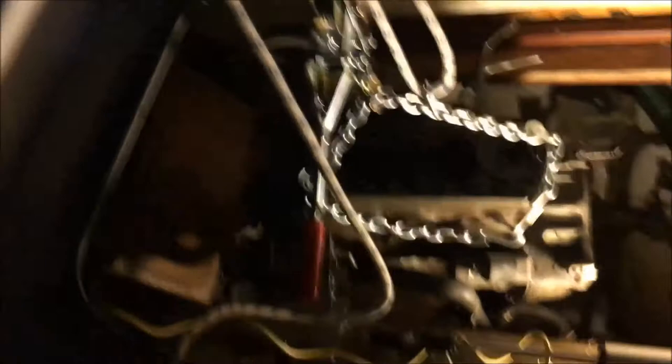The thing I didn't realize was that my come-along was going to be so short. So I had to devise something ingenious to get it out of there, and what I came up with was two lines instead of one. I pulled the engine up as far as I could, cinched up the other line, lowered the come-along, pulled the line up another three feet, and then put my come-along back on and raised it back up. It's a hard way to do something, but all the stores were closed — it was three o'clock in the morning and there was no way I could get another come-along.